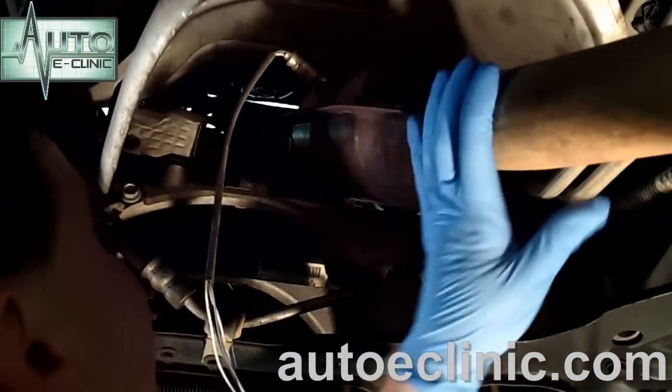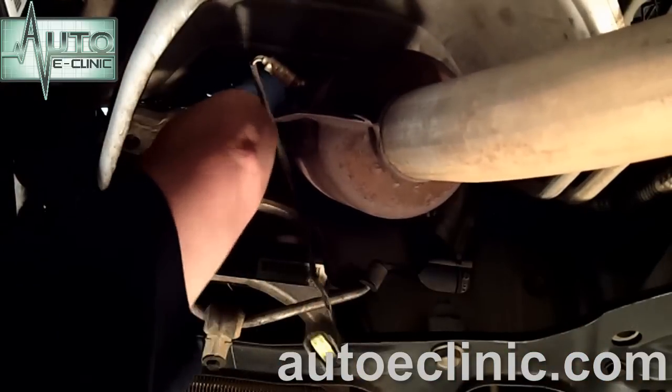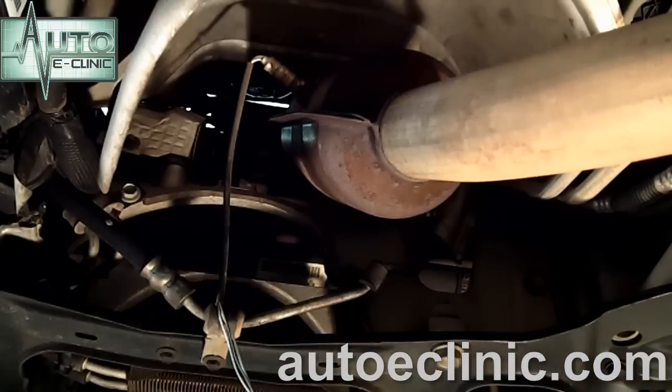You want to go ahead and disconnect your O2 sensor. And we'll get our four bolts off up there — looks like 13 millimeters. We're going to have to hold that one. Got our bolts broke loose, just about all of them.